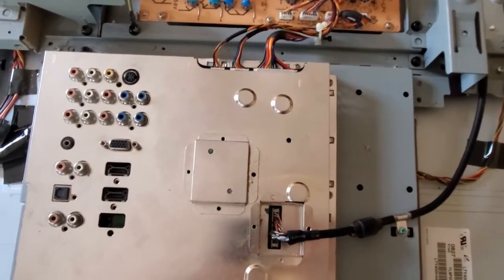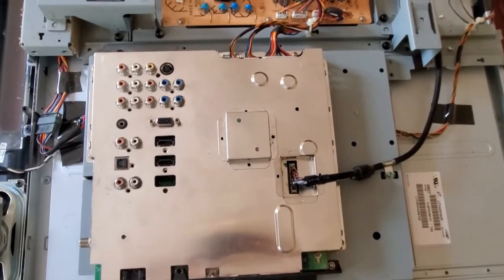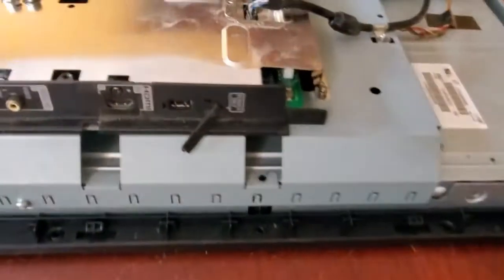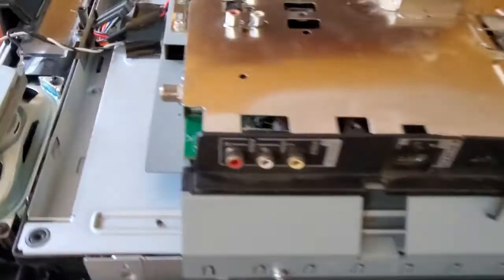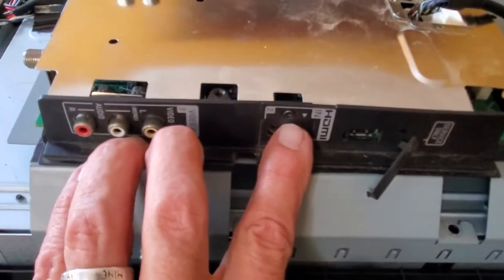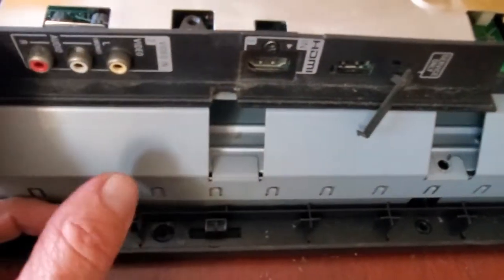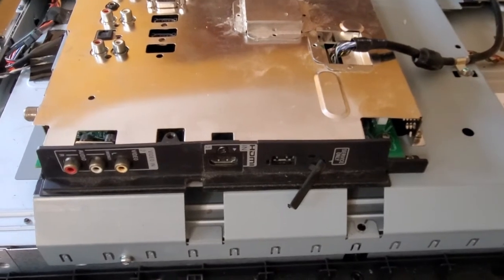The X marks show where the big screws were, and the little screws go in the other holes. After you put all that together, don't forget to put your little nut back on the coax cable connector. You're going to have to put this black screw in here and this screw here too — this is your little cover for your jacks and everything. So let me get the cover back on and we'll hopefully see if this thing will work. If there are any challenges or problems I come across while putting it back together, I'll shoot that video too. Hopefully this thing works — thanks so much!